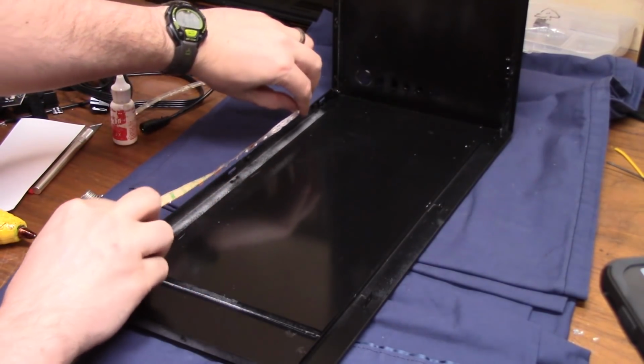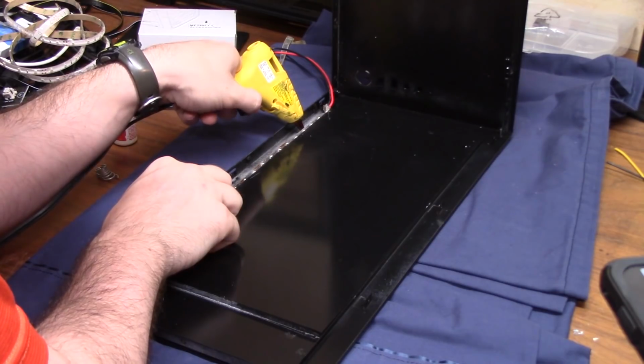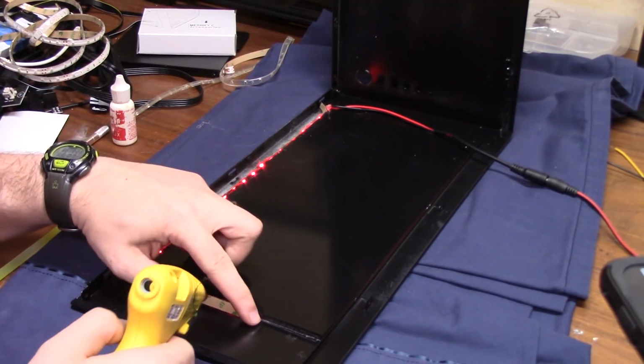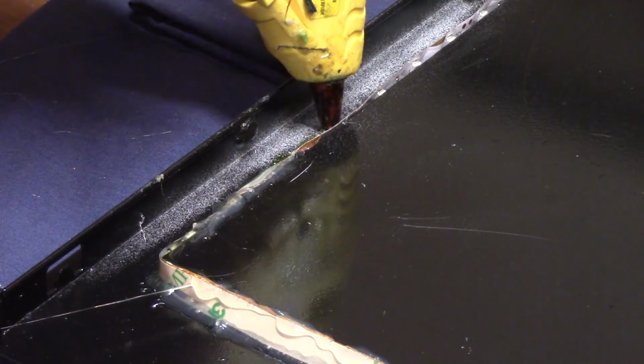And for the front panel Tachanka silhouette, I wanted him to light up red, so I took this red LED strip and soldered some wires to it, and it plugs into the Molex cable on your power supply, so anytime you turn on your computer, Tachanka will light up as well.